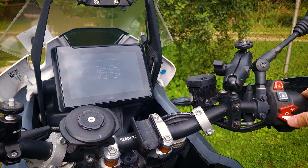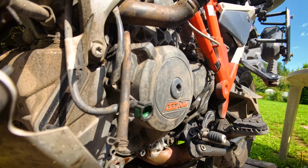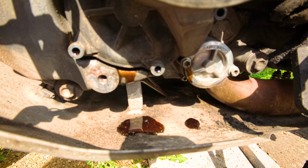By the way, it seemed to me that if the motorcycle has a dry crankcase, there should be no oil in this cover, but I'll save you some time right away, there is oil in there. It leaks out when you unscrew that cap. So immediately remove the protection and everything else, because you still have to drain the oil.